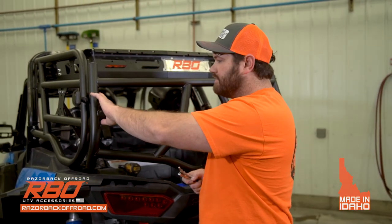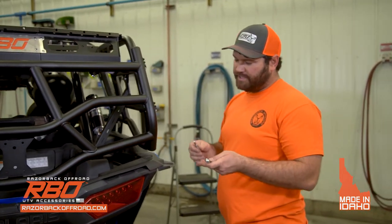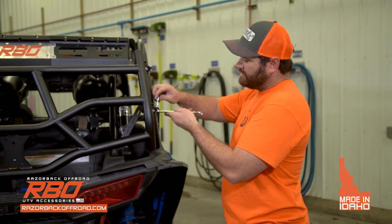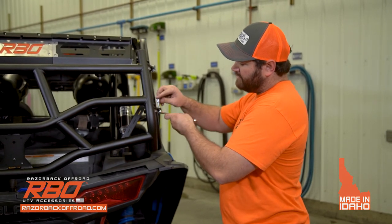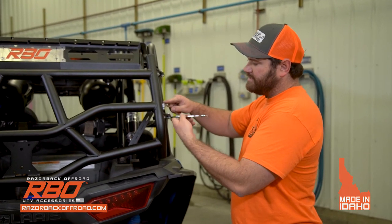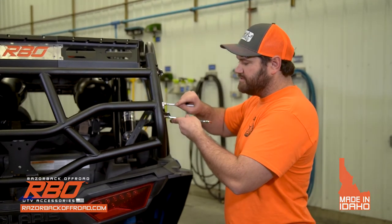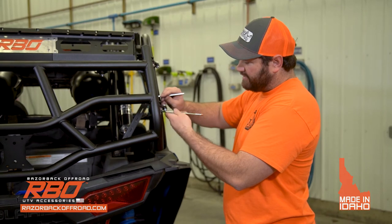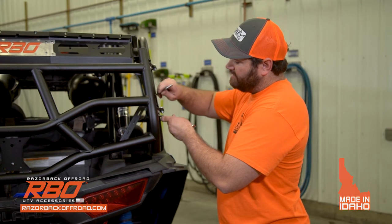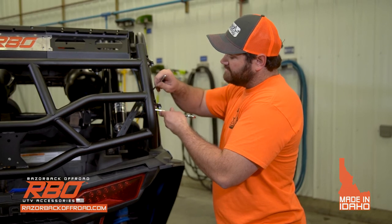Okay, so once you have that snug, now you're gonna come over to the tailgate bracket side, and you're gonna wanna grab your 1/4-inch Allen wrench and your 1/2-inch drive. On here, you're gonna wanna snug these down, but not too tight, and I'll explain that in a minute. You're gonna wanna get them tight enough to where it can kind of hold itself a little bit, but you still can adjust it. That's kind of hard to explain, but you'll see what I'm talking about in a minute. So you're gonna come through and snug them just enough to where it could kind of hold itself.